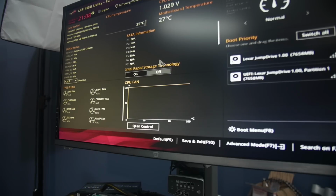That might not sound like much, but on prior Asus motherboards, for example, if you have a Sabertooth or the X99A or the X99 Deluxe or some other X99 model from before Broadwell E came out, and you were to buy a Broadwell E CPU and you happen to get old stock on one of those motherboards, you would not be able to boot that CPU in the motherboard.